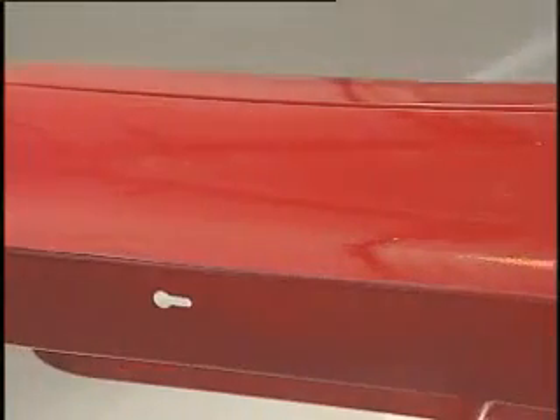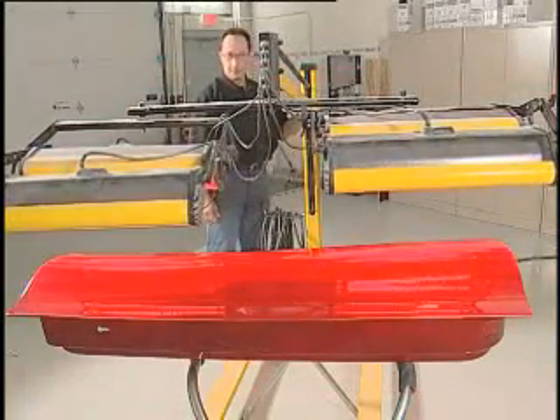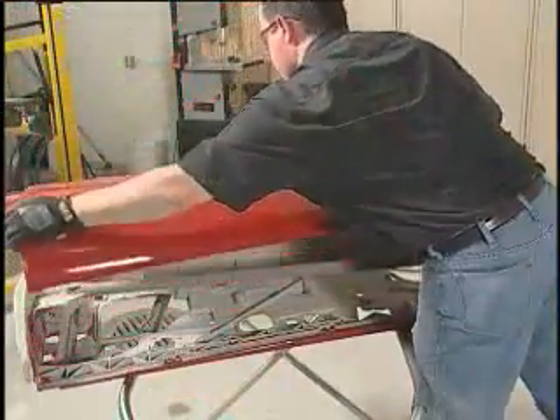When removing a composite door panel, use a heat lamp or heat gun to weaken the bond. Use a chisel or a putty knife to separate the seams. Once the original panel is detached, use an angle grinder to remove the existing adhesive from the bond surface.